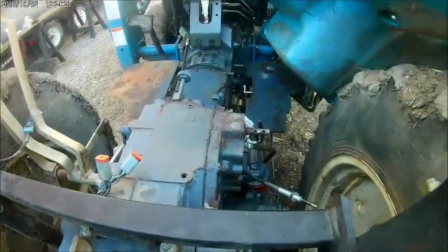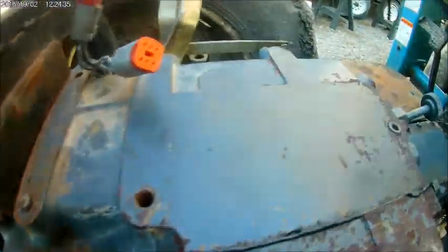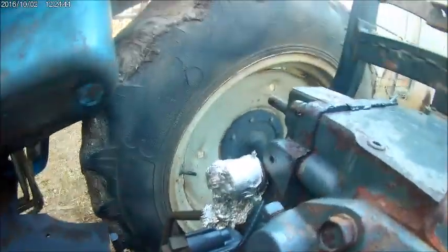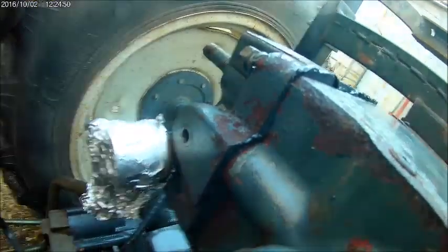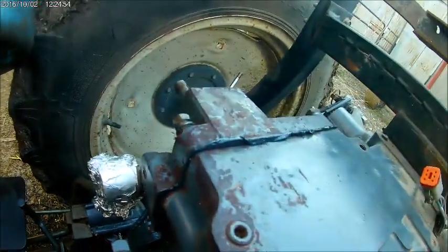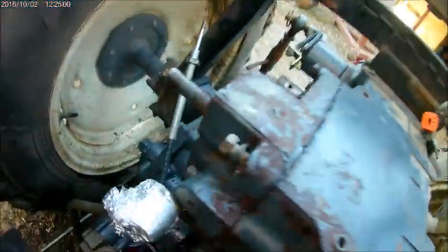So okay, here comes the fun part. All this work for this moment, to make sure we get a good sealing surface and that it works, and that's the ultimate goal, no leak. So we'll be back in a little. All right, real quick, got it installed. You can see the bead starting to come out the edge just like it should. We'll inspect the front part of it that was doing the leaking, make sure that's got a nice little bead all the way around it, and we'll see how all this transpires. At this point, I'm gonna go ahead and shut this back down again. I'm gonna go ahead and finish putting on the bolts.